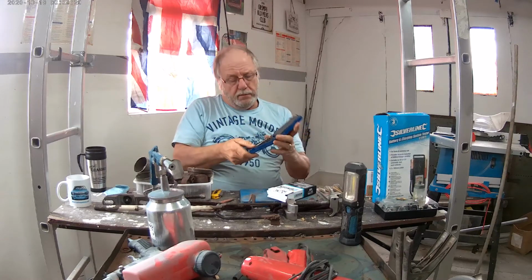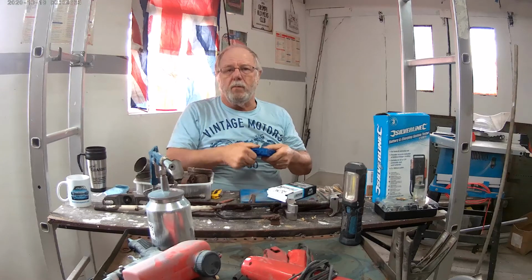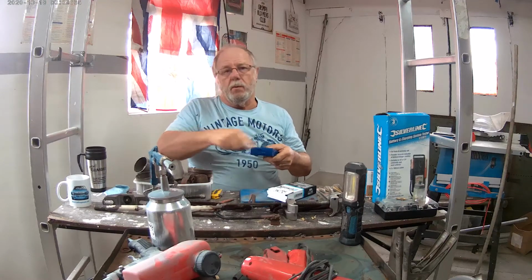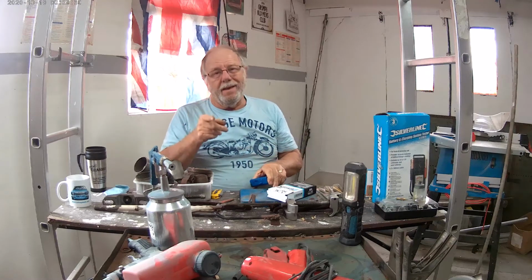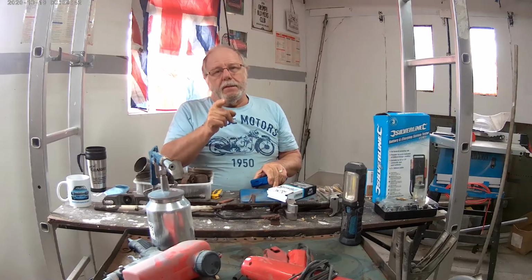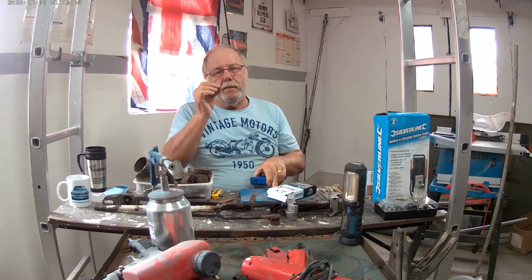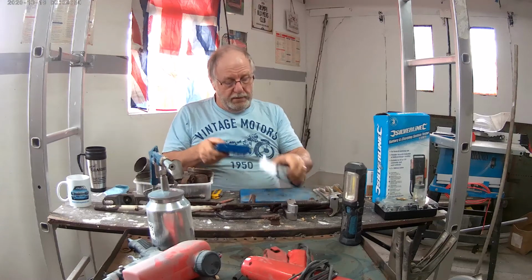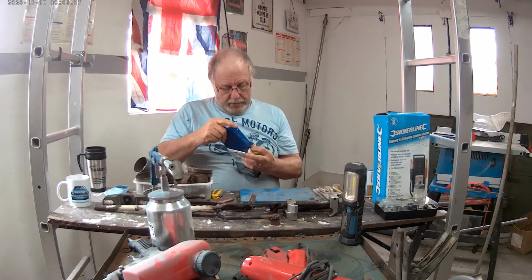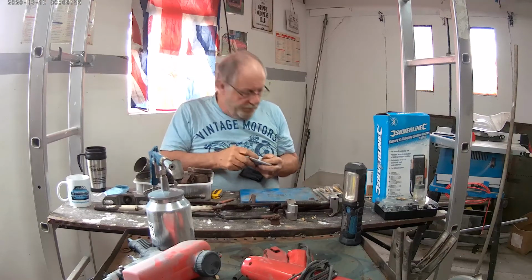There's also spot weld drills. They're just wide drills with a wide sweep that will cut the spot weld out. But that way, sometimes it goes straight through and you're left with a hole in the panel that you want to weld to. Some cases it can work, some cases it can't. So that's another tool.